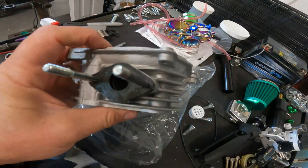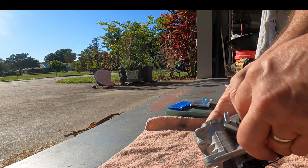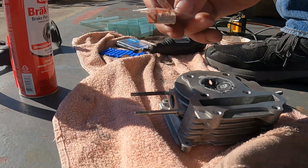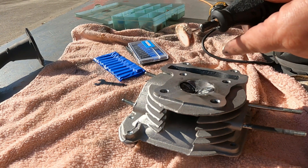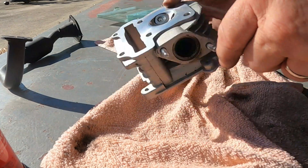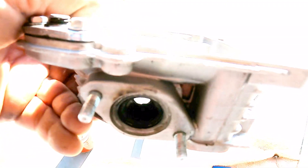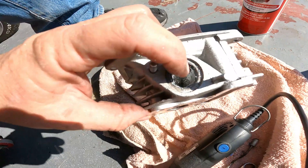The main thing to do is port matching the intake — getting rid of little bumps right there. There's quite a bit of meat between the port and the valve area; maybe I'm supposed to transition that better. The little teeny wire brush seemed to take that off pretty well. The guy said to polish the inside of the head — my dremel kit came with jeweler's rouge, so I hit it with that first, then used Mother's polish on a little fabric wheel. He said to leave the valves in for that part so you don't nick your valve seat. Then take the valves out and smooth out what he calls the floor of the exhaust and intake port — that's the bottom part. Just smooth that out; don't try to make the hole bigger, just smooth the transition where the port meets the exhaust pipe and where it meets the intake.